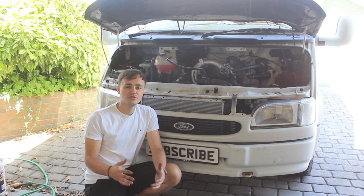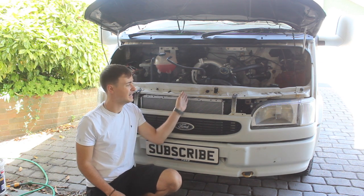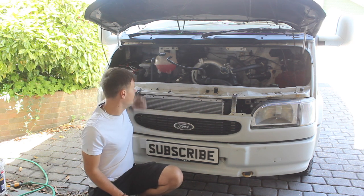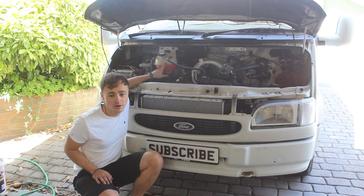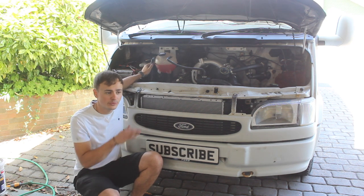So all that's left for me to do now is take it for a little test drive, and by doing so we'll push any air out from the system and then we can just top up the reservoir as required, and it wants to be in between the minimum and maximum line once we're on level ground.